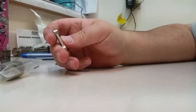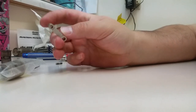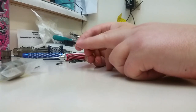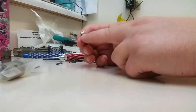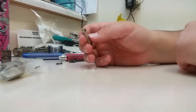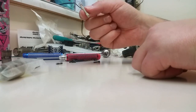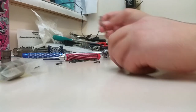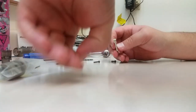This is a thing with the Traxxas Pro 15 engine. They have no bronze bushing in the top of the connecting rod, and they have no oil hole here. So there's not even any chamfer to wick the oil in. What happens is this gets all loose and sloppy in here, and the piston starts spanking the head, or the rod breaks. So with a Pro 15 connecting rod, which is interchangeable with an OS 15 and 12 CV, drill an oil hole in the top, like a tiny little one. Use a drill bit that's that small and you can get away with it.